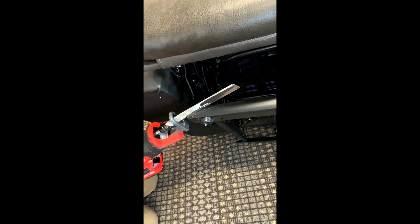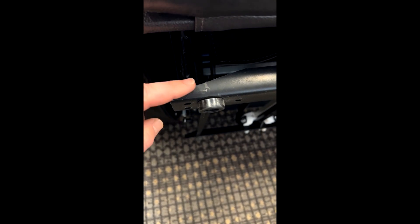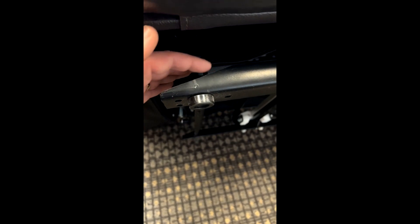To make the modification to the front rail, I will use a reciprocating saw and a steel blade to remove the material. The completed modification removed about a quarter of an inch of steel. After that, you'll want to deburr these edges using a file on both the inside and outside to remove any sharp edges, then apply a coating of black paint for proper rust protection. And that's how you complete this modification.